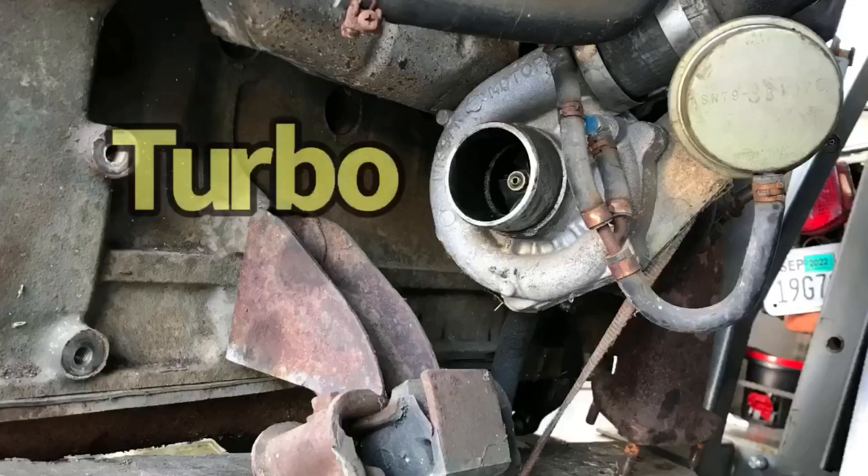So low compression, while normally associated with turbocharging, at 7.4 to 1 is pretty low even for a turbo combination. Way back then, without sophisticated electronics and without an intercooler, it was probably necessary. But it would be much better to step up to the naturally aspirated compression ratio, which was only about 8.5 to 1 — not a big jump and a number we normally associate with turbo applications.